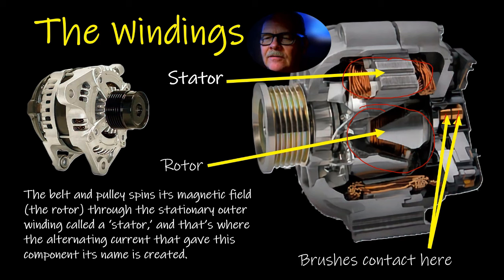If, for some reason, a full-fielded alternator will put too much juice in a battery and boil it. Typically, when you had one that was overcharging, like when you hooked your charging system tester up and it was putting out 18 and a half volts or something stupid like that, you would typically have a problem with the voltage regulator. That was where the issue was most of the time. It could be something else, but usually it was the voltage regulator.